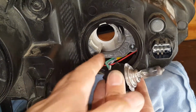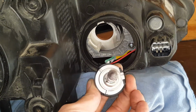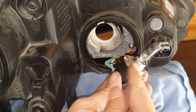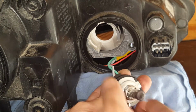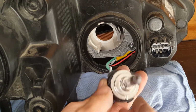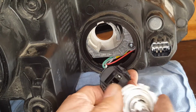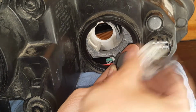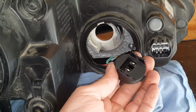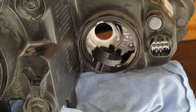And you can see that's a nice burned out bulb. This said, pay attention when you take it apart. You see how that part goes into this notch here, and that's exactly how I put my LED on there. I don't care about touching this, but if you're putting a new halogen in, have gloves or paper towel or something. You don't want to touch your bulb. If you've got another halogen, you just plug it right back on there and twist it right back into place. Pretty simple. And it's only going to go that one way.